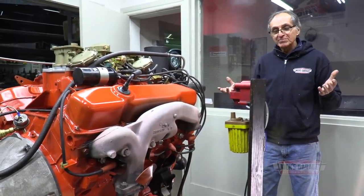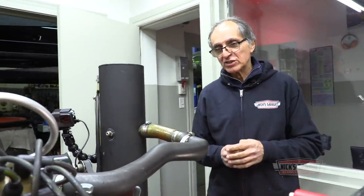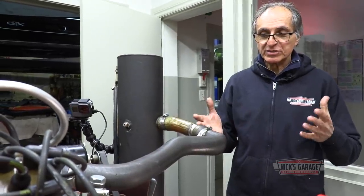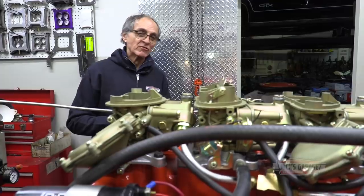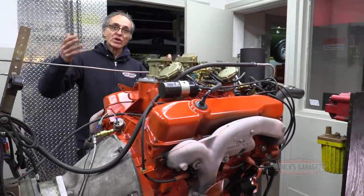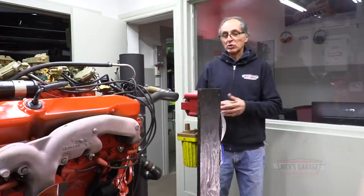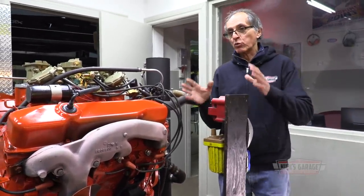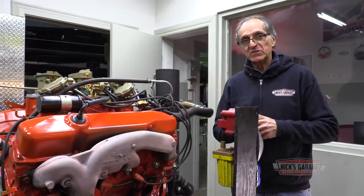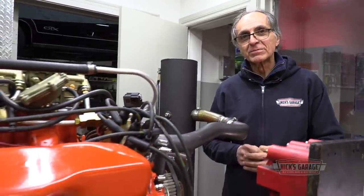If you're talking about transmission tuning, well, that's another story. That is something I think you should work on with a chassis dyno, not with an engine dyno. All I know is you can perform some acceleration tests with this setup, but I'm not too concerned about that. What I need it for is, like I said, a lot of people just want to know what horsepower and torque they've got at a given RPM. Knowing that, you can set up your car: gear ratios, tire size, torque converter, stall speed, the weight of the car, everything. You work around what you've got here, then you fix up the car to your engine specifications. I don't work with transmissions. This is what I use my dyno for, and what my customers want, I give them exactly what I've got here.